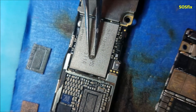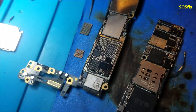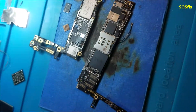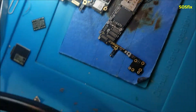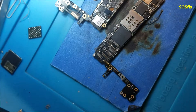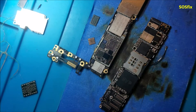You can see how dirty the Mesa chip was underneath, and the corrosion under it. There are also black spots under the touch IC chip. Thank you for watching — hope this video helps you fix your device or gives you an idea of what the process takes. Fixing a water damage phone is sometimes not one problem — you clear the short, change a chip, fix the traces, and sometimes resistors too. Please subscribe to support this new channel. See you next video.